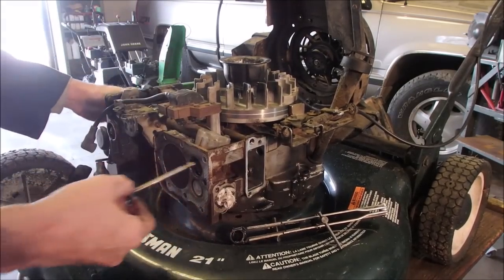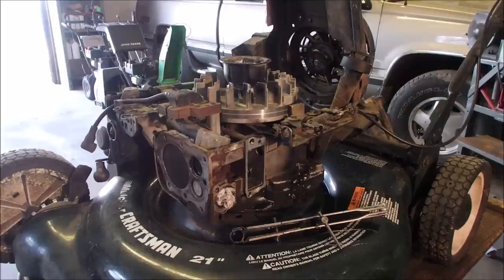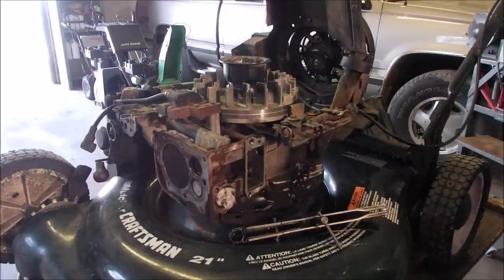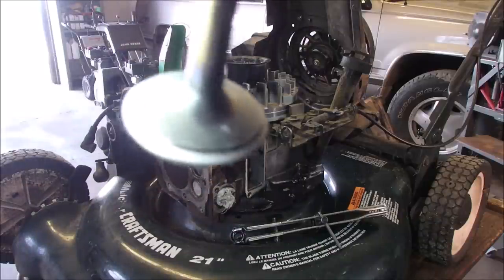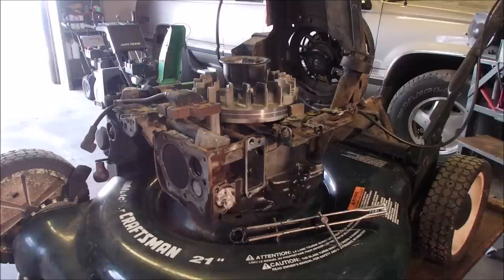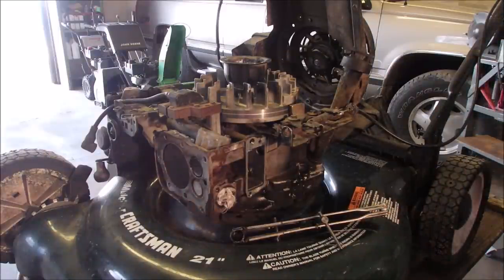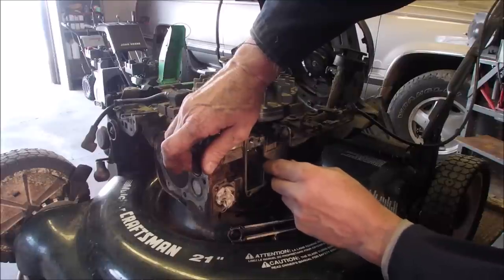Let's look at that bevel — get a rag. There should be a gray line around that valve now. It doesn't get any better than that, guys. I'm going to just recheck my depth and then think about the other valve. Oh, that's perfect.